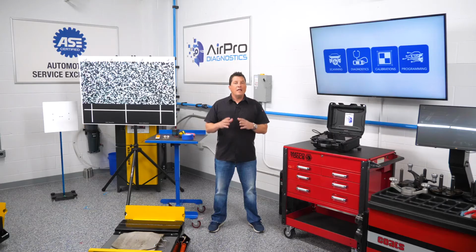Keep in mind that all this space must meet the OE specs for being level, and you need to document all the time and labor that needs to be billed. As you can see, recalibrating ADAS systems is much more than just buying the equipment. Make sure you look up the manufacturer's preconditioned requirements before you embark on any calibrations each and every time.